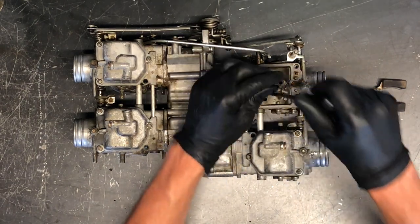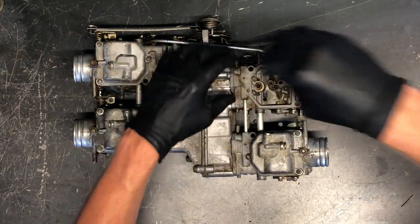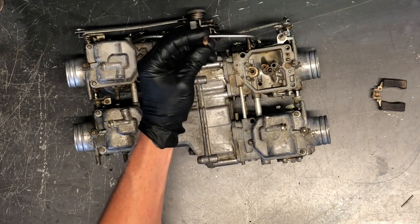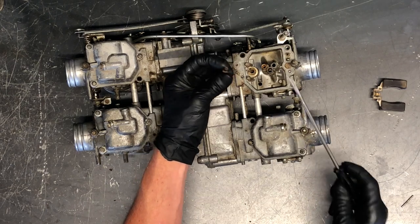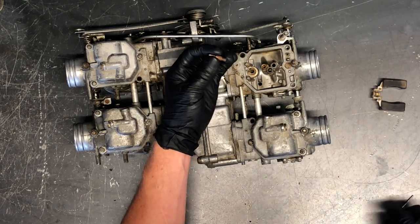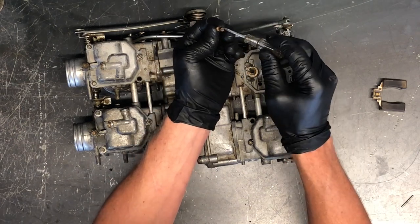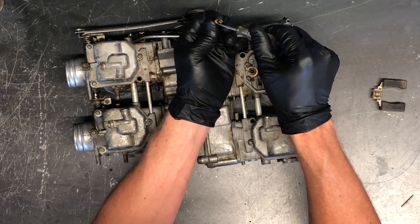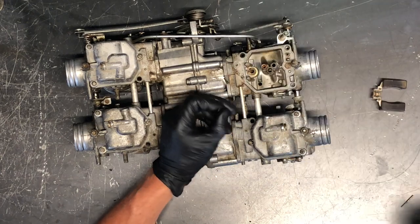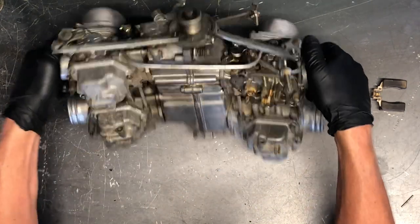The pilot jet is down inside this port. Use a screwdriver that's large enough to fully seat on the pilot jet so you can turn it without rounding it off. Screw it out and there's your pilot jet — the orifice is extremely small, so blow through it with compressed air and carb cleaner. The reason to use a larger flat screwdriver is that a very small one will turn inside the jet and waller out that hole, breaking the tabs or damaging the assembly. Use the largest flat screwdriver that still fits down inside that port.